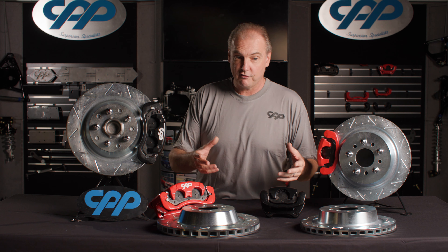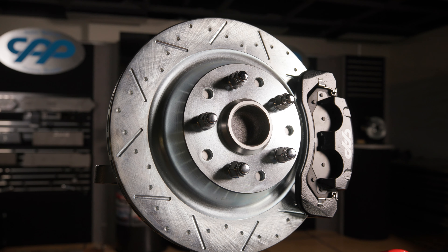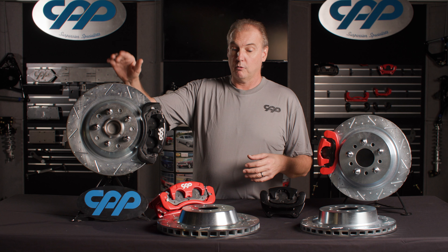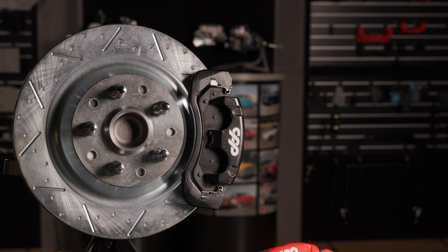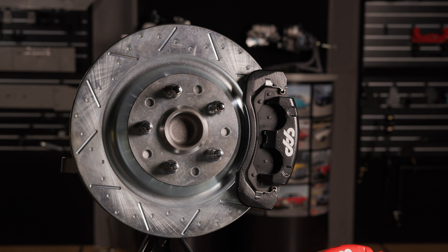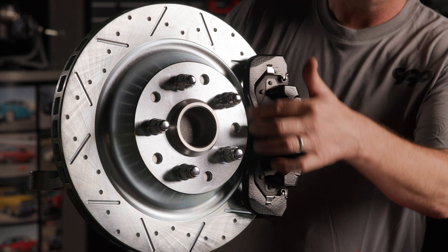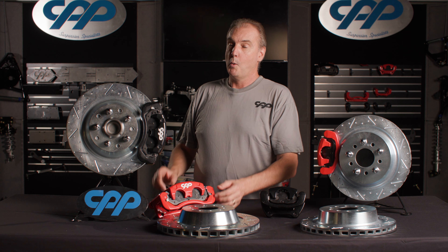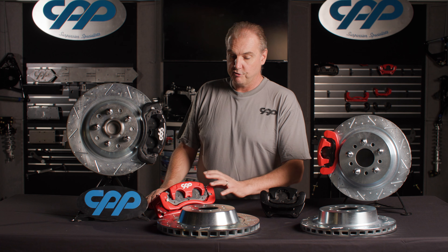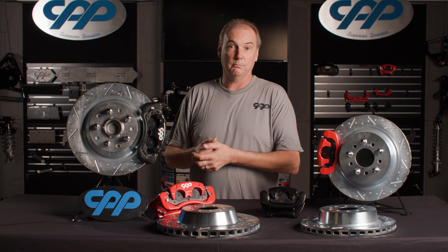It's a pretty straightforward upgrade — really straightforward for anyone that's bought our big brake kits over the years. We're going to swap out the rotor to the new bigger rotor and unbolt the caliper — it's a new caliper assembly. It's really the same caliper with a different bridge. The part that goes around the brake pad right here, that's what's different. So it is possible to get just the bridge and the pads and not a whole caliper, and do an upgrade where you don't even have to bleed your brakes.